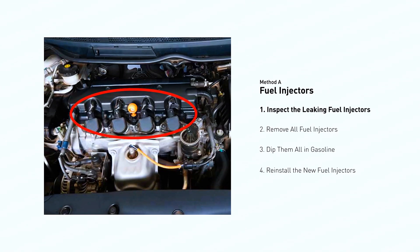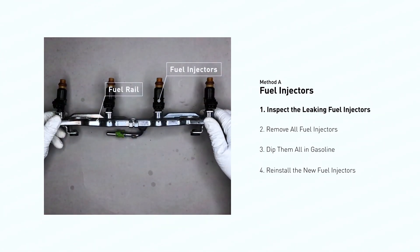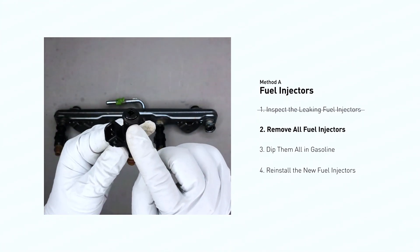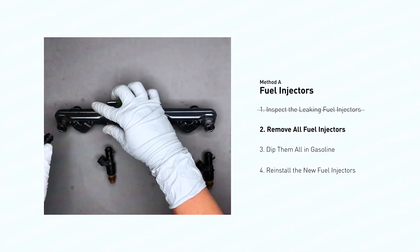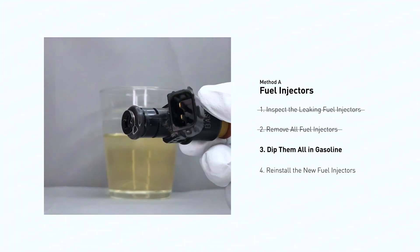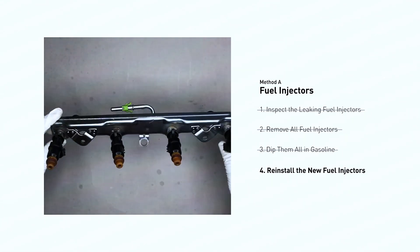The fuel injectors are mounted in the intake manifold so that they spray fuel directly at the intake valves. Inspect the leaking fuel injectors on the fuel rail. Carefully remove the fuel injector, make sure the new injector has new seals, and never reuse the old seals. When you change the fuel injectors, change them all as a set — otherwise the engine will run unevenly. To prevent leaking, put some gasoline in a cup and dip the new fuel injector into it so the seals get wet, and it will seat properly without leaking. Then slide all the new fuel injectors in.